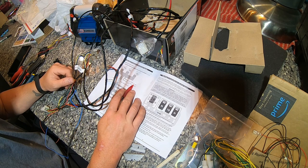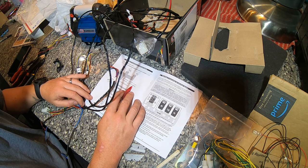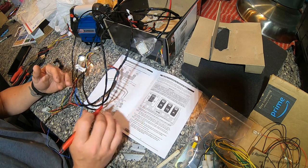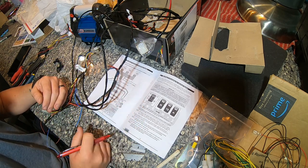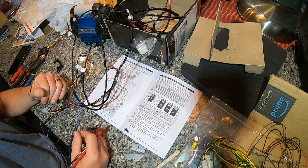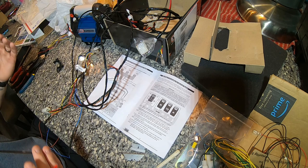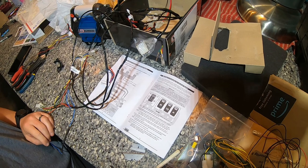The dash illumination — sorry, the ignition wire — provides power when you have your vehicle turned on. The light wire is for when your headlights or anything else come on. I'm going to have those basically hooked up to one switch so that when the switch is in the on position, both lights will come on, and both will be off when the switch is off. I'm not worried about having a constant light on the switch — everything is underneath my hood and I only want to know when it's on. So we're going to cut those off.